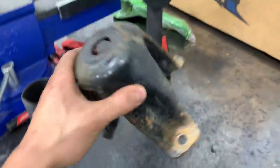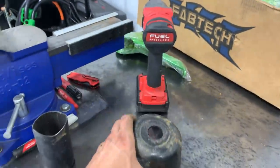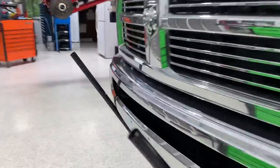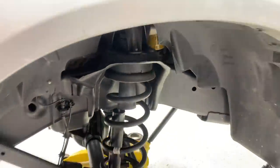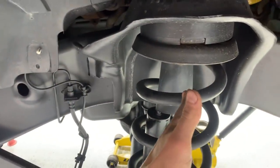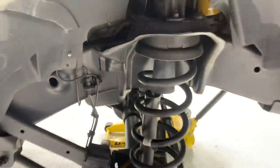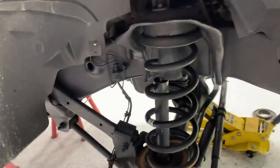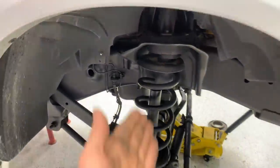This shock fought us when we did the leveling kit — we actually had to cut it in half. The only piece we need is this little stand right here, because that's what the new shock mounts into. On the other side everything is still in place — this little tripod holds the shock up in there. They got rid of this design in 2013 and switched to putting the shock and spring separately, which is a little nicer to work with. We have to get the bottom of the shock out so we can fish the spring out.